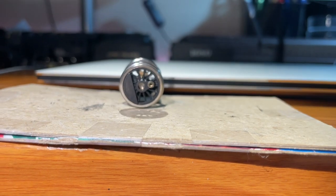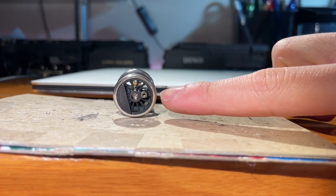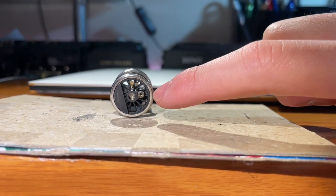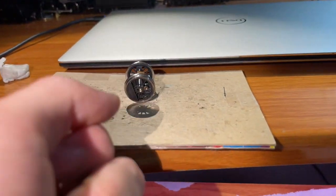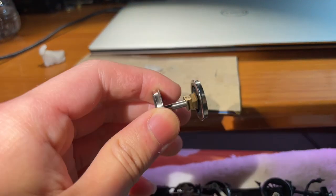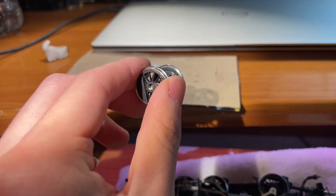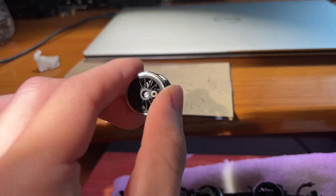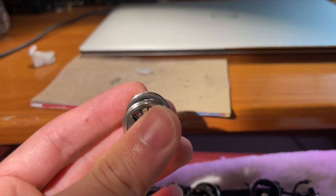You can see it's not exactly at the 3 o'clock position — it's a little high, looks like around 2:30. So now I'm going to use two hands and just twist, grabbing one wheel in each hand, and use the other hand on the other wheel to twist it just a little bit to adjust. I'm going to check again and repeat until I finally get it at exactly 3 o'clock, or at least until the two wheels are 90 degrees off. I'll do that right now and be right back.